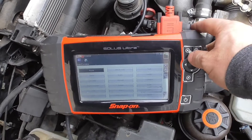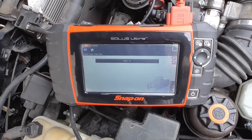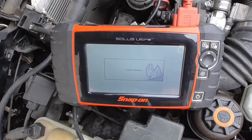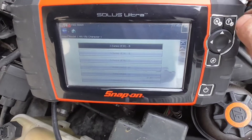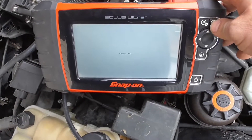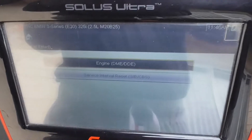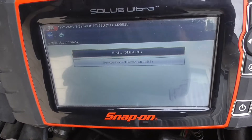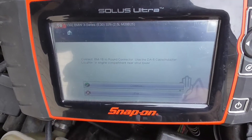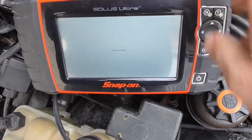E30, 87 to 93 — let's check it out and see if we can diagnose it with this. It only goes back to 92, which is fine. 1992 convertible is E30, so let's go. I'm going to choose engine diagnostics — connect the BM-1B round connector to the diagnostic port, which I did. Yes, communication.